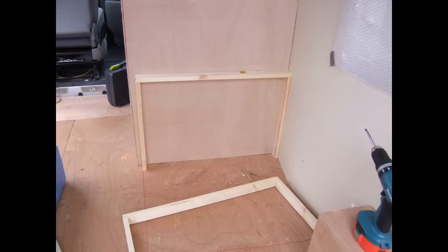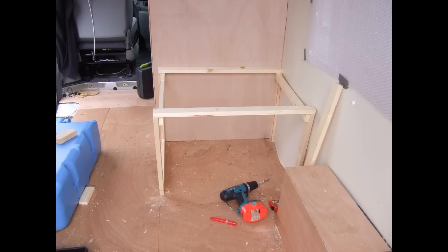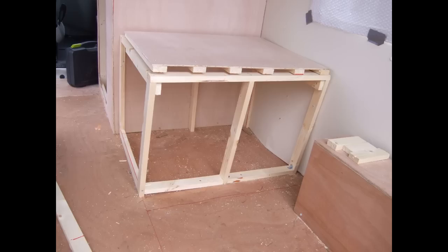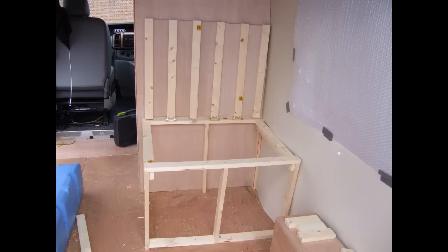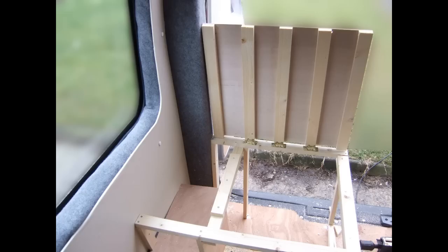Next up are the seat boxes — very simply made by building a basic wooden structure and cladding it over with plywood. There's the rearward-facing seat with a lid giving storage inside the seat box, and here's the forward-facing rear seat, once again a simple structure to be clad over later. Both seats lift up for storage space. Here we have the bathroom door, edged with edging strip — I've made a separate video on how to edge doors with a link in the notes. The door is held in place with simple furniture hinges.